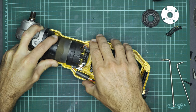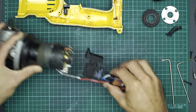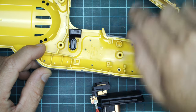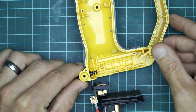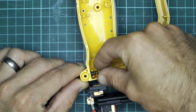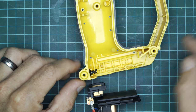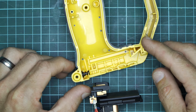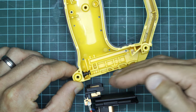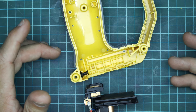The electronics are just popping out, and the motor will just kind of pop out of the casing — fairly simple to just lift everything straight out, as it is with most of the other tools. Something to keep in mind when you are tearing down your tools: some of them have this little spring with a little plastic stopper. That thing is normally situated behind the little battery terminal connector. What the spring does is it keeps forward pressure on the terminal connector, so that when you clip your battery in, it presses the terminal backwards against this spring, and it stops the battery from vibrating around in the holder. If any of you know differently, let us know in the comments.